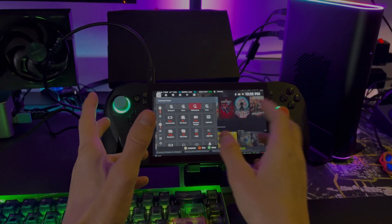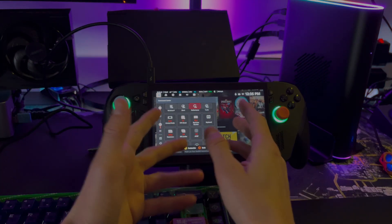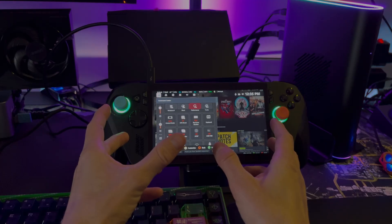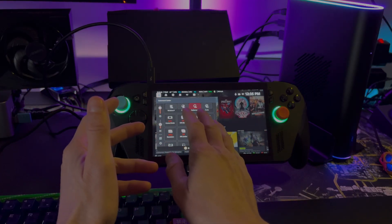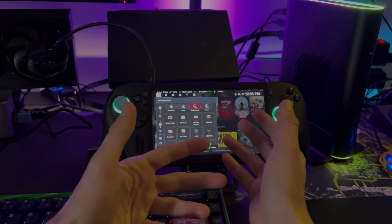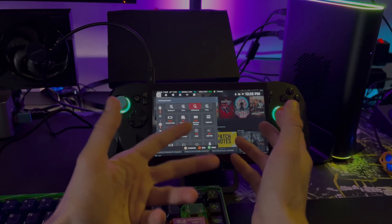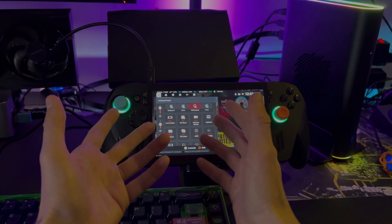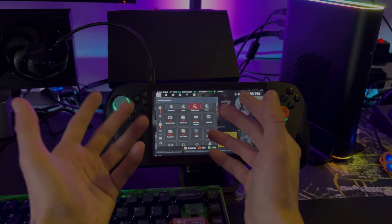When connected to the eGPU, I typically leave the device at 17 watts instead of 35 watts, because you really crank the watts on the actual device when using the iGPU. When you're not using the iGPU, it's best to leave it at 17 watts. You'll notice it won't get as hot and performance is actually very similar. The most you'd want to do is maybe 20 watts for a custom TDP — I wouldn't push it past that because there's no need to.